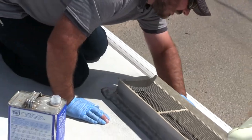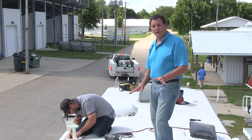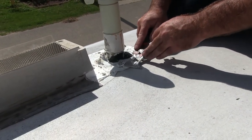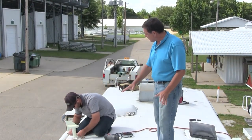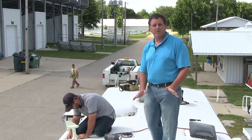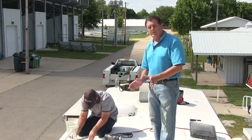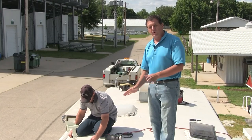The first step in the process is cleaning the old roof, which we've just finished. The roof is cleaned and dry, and now Robert is removing some of the old sealants before we start. Today — day one — Robert is cleaning everything off, and then since this is a rubber roof, we're going to use our priming system. In a little bit you'll see us prime the whole roof, which will turn it a yellowish color — almost a clear coat — that stiffens up the old rubber and gives us a nice clean primed surface to work with.